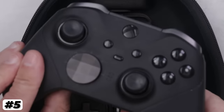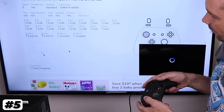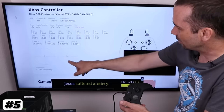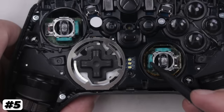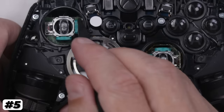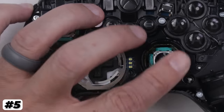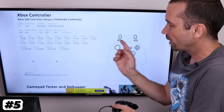Here's number five. Let's test the left stick and see how much it's drifting. So I'll move the left stick all the way over and it doesn't even go all the way. This one I think is probably a faulty potentiometer inside the analog stick, but let's open it up and try to clean it and see what we can do. Also the right analog stick is drifting pretty badly as well, so both of these need some attention. These two analog sticks are very dirty inside. It looks like the cover has been hitting on the edge and kind of wearing it away — somebody's definitely abused these.